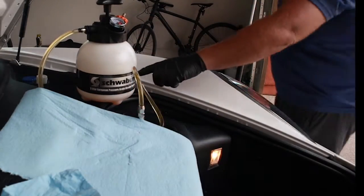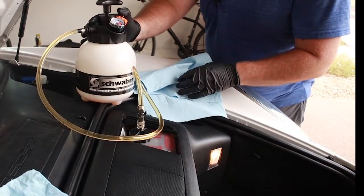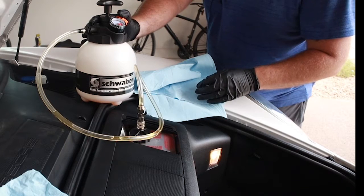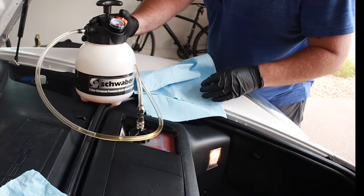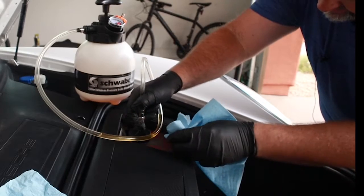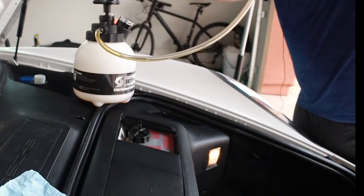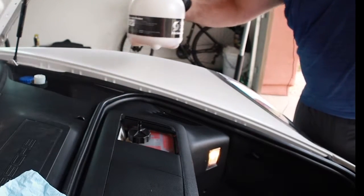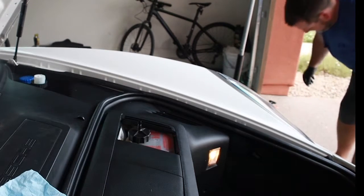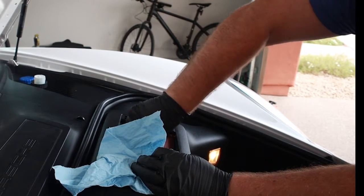So there's still fluid left in here. I think we're gonna have to top off the cylinder, which is fine. Let's take the pressure out of the system. It should evacuate most of what's in the line. Make sure we're fully depressurized before we pull the quick disconnect. Lift it up so the fluid can run back in. And let's get this guy out of the way. Now we'll remove this guy.